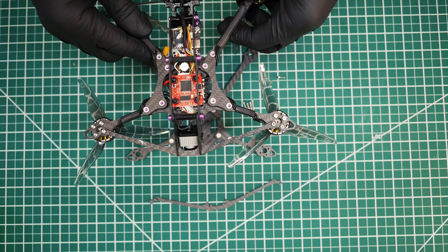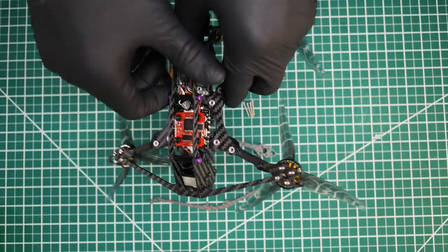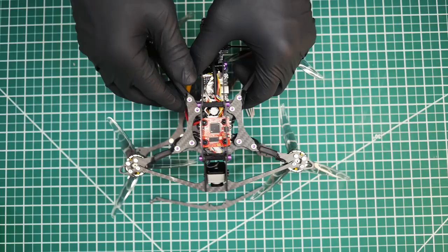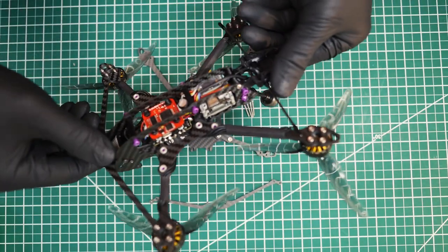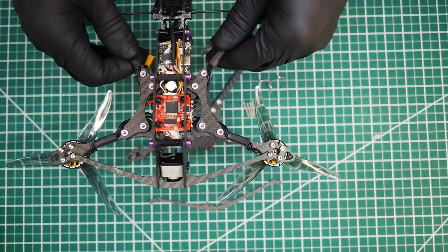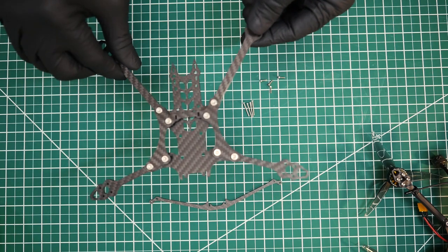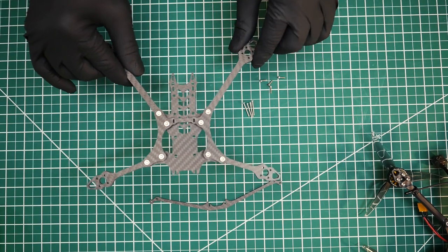Now I want to talk about the ESC and the stack in general. This is mounted upside down — the top is where the battery goes, and underneath in the belly is where your stack is. That's a little unorthodox. This design is reminiscent of Tommy's design — he goes by Ummagod — so if you're familiar with that build this will be no problem. It's super easy because you're just building up your stack on a plate like you're used to. Whenever the thing flies it's upside down, so you'll need to make adjustments in software, but it's not hard to do.